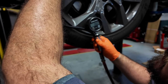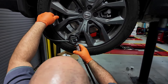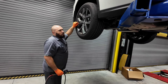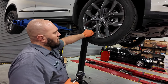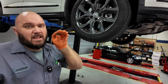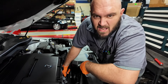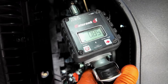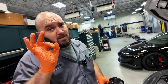Recommended pressure on this is around 33-34, but for highway driving and the cold weather we're heading into, I'm going to jack it up to 40 — gives a slightly rougher ride but I'm also towing, so I want everything in good shape. You also get a little better highway mileage with more air pressure. Got some cool Acura accessory A-Spec valve caps. Oil weight: 5W-30 or 5W-40? I like it thin. 5.8 quarts — well, 5.7 but I put a little extra in for insurance. That's because Mike's going to be driving this car in the mountains and that scares me.